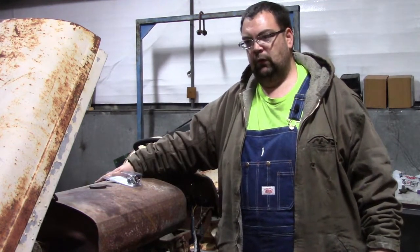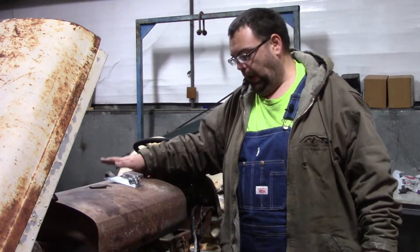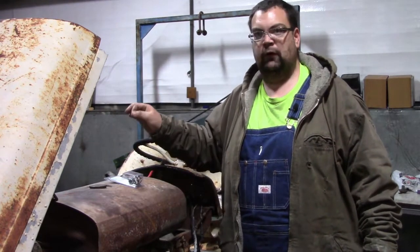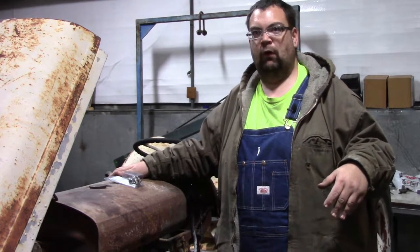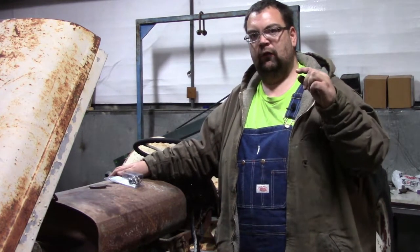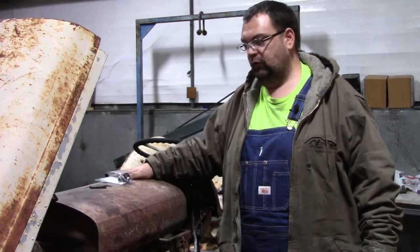And then on the last video we did over at Crazy D's equipment, it would putter, but wouldn't take off. And the more we messed with it, the shorter the period of time it would try to take off. And at the very end, we did some little work after the video on it, and I had no spark again. So I did a little research and figured out that the condenser is going bad. So that's what we're gonna do, guys. We're gonna put new points in this thing and see if we can get it to take off today.